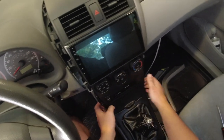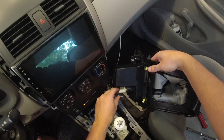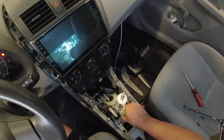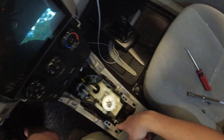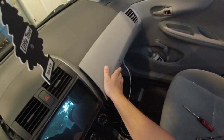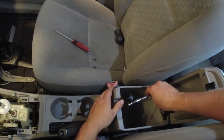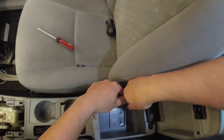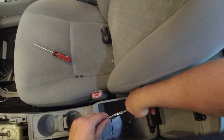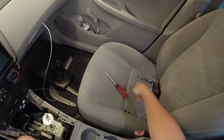This should pop off. There will be a 12-volt connector right on the back — just squeeze that and we're out. So the whole goal is we've got to get this whole shifter assembly out of here. You can see the 12mm bolts down there, and then there's two more 10mm bolts down in here. Alright, we'll get these 10mm bolts out of the center console. I've had this car for over a year and I never knew I had a 12-volt outlet inside of here.